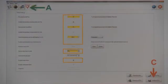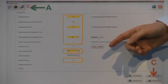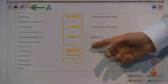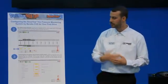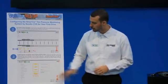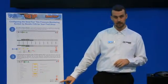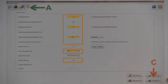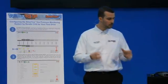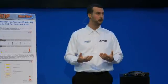So those are the three main values we want to make sure we check as the system gets readied for the first drive, whether you're a dealer, an operator, or a factory technician. Lastly, there are a few additional settings concerning the learn modes — those can stay with the Bendix recommended defaults unless you have a particular desire to have the system learn new sensors automatically. We again want to make sure that every box has a valid setting before we write to ECU, which is our last and most important step — writing to ECU will commit all your changes, highlighted in yellow, through the DLA onto the ECU on the vehicle.